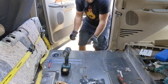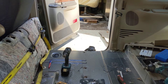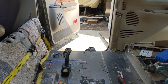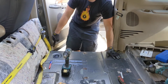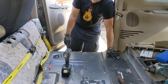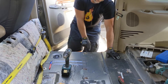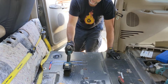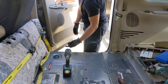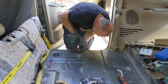I'm going to take a quick peek underneath and see what we got. One more thing I'll say is when you're going to do something like this and drill through a floor, don't go drilling blindly through your floor. Get underneath and just see — make sure you don't have any fuel lines, brake lines. In this case all the AC lines for the back run down this side, but I'm pretty sure they're over here on the outside edge. Just check and make sure there's nothing under there, because otherwise this turns into a much bigger project and a lot more headache. I'll retrace one of my holes because it was traced onto the sound deadening material. Hopefully I don't break the bit.